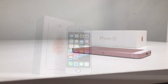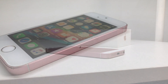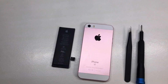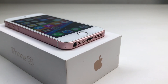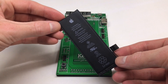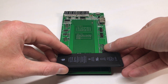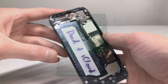The iPhone has been retrieved. The reason it wasn't powering on was the battery — it was stone dead as a result of being drained below its threshold. With lithium-ion batteries, once they go to extremely low voltage the iPhone will refuse to charge that battery because it's below the safe threshold, so you won't see the battery flat icon and the phone will just refuse to charge. Putting a different charged battery in means it charges right up. To retrieve the dead battery I connected it to my battery charging board from eBay and let it charge for a few hours — I was actually able to bring it back to life.